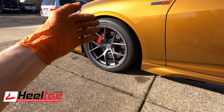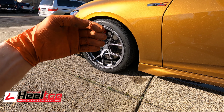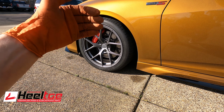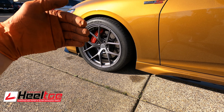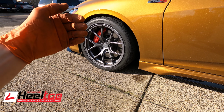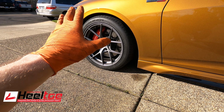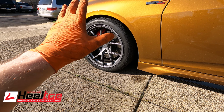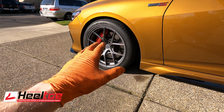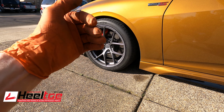So effectively, this wheel compared to a factory one is going to be the 55mm offset minus the 13 because it's a 37 offset wheel, minus 12.5 again because of the extra width. So because of the 13 and another, we'll just call it another 13, 26, this is about equivalent to what the factory wheel with a 26 or 27mm spacer is going to look like. So think like that when you're looking at how this fitment goes, and understand that H&R does have a 27mm spacer, but if you're looking to go just a little in from there, the 25 is maybe a little safer.